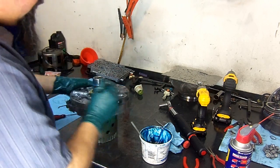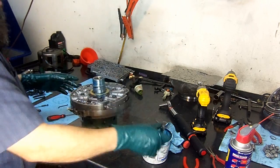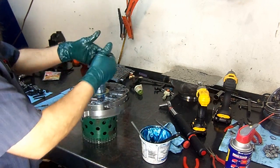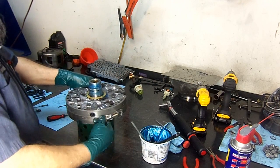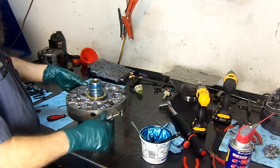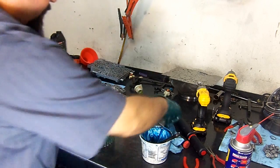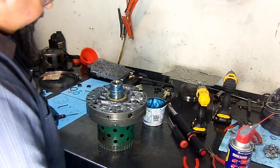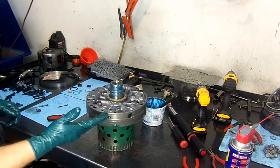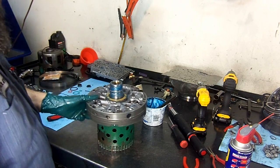You can also install 700R4 sealing rings that are blue in color — they're not resizable, they come pre-cut, and they work great. Keep some extras in case you're ripping rings. And there we have it — the 4L60E pump fully assembled.